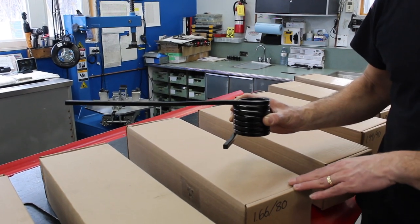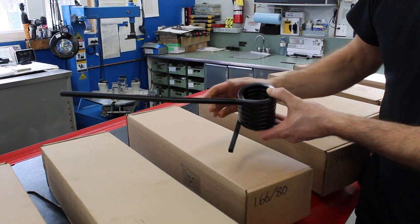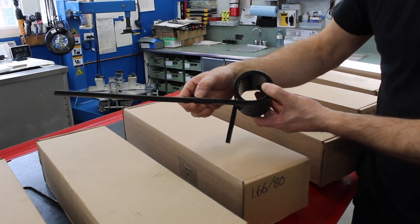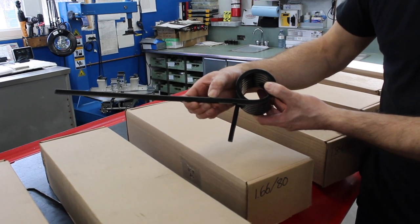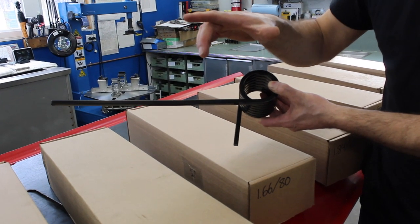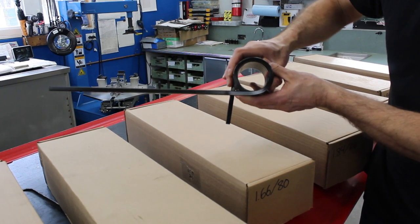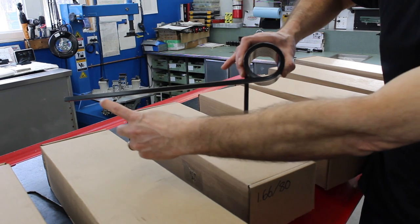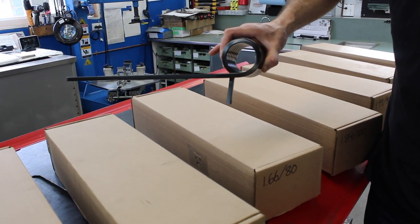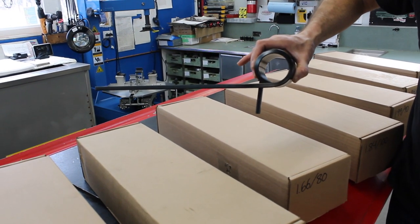When the gear or rider gets heavier, this spring is not enough. We grabbed a 16680 torsion spring out of the box to show you — you can read the nine-digit BRP part number here, and then the rate 166 and 80 are written there. That 80-degree angle: if you look, the main part of the spring and the tail are not quite at 90 degrees — this one is at 80 degrees.